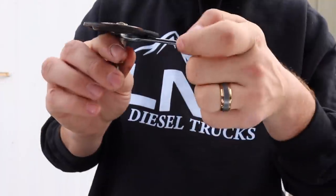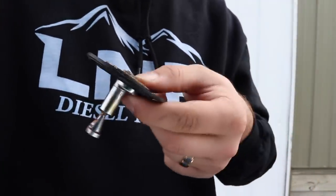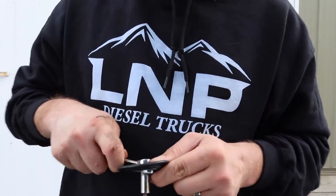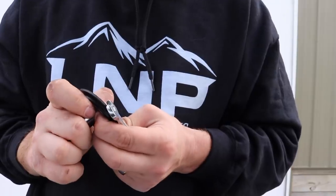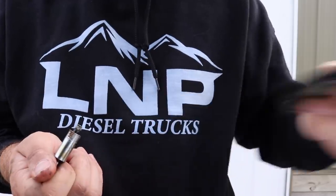When it comes to removing the fuel pin it's actually pretty easy. You're going to take a 10 millimeter, put it on the stock one — it's kind of notched out with flat edges for a 10 millimeter wrench. Just hold it with your thumb and take your 10 mil for the top. Give it a little rotation and it breaks loose pretty easily. Just don't lose the nut — it should just push right out. There's a washer on the top so don't lose it, it's really tiny but you've got to have it. There's your stock fuel pin.